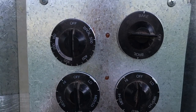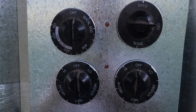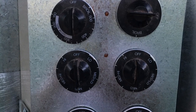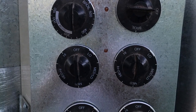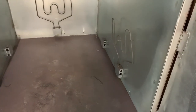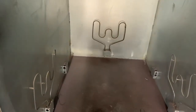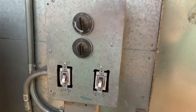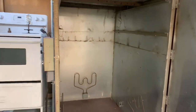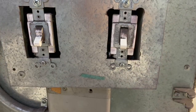Originally when I built my oven I had a sacrificial lamb oven and I took the knobs and all the controls off of it and built my own panel, but it didn't work. The stovetop heating elements — the little coil ones — those switches don't let as much electricity through as the oven or broiler ones, like those 3,500 watt heating elements. So I had to switch them out and I put two 220 volt electrical switches, and that's what's operating the heating elements inside now. Since I put those up I haven't had any issues.